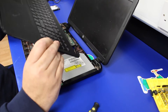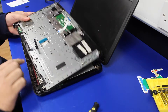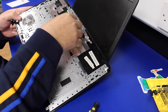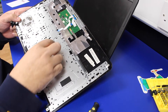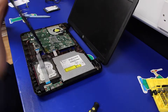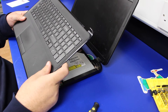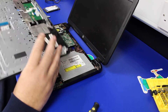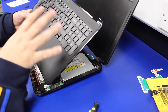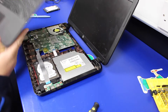With the cables already undone we can lift the whole top lid off the laptop. You can see there you've got the power cable here which runs to a power switch on the underside of the board, the trackpad cable that goes to the main board, and that's the keyboard lead just coming out of the metal underneath. I'm not a great fan of this design where the keyboard is an integral part of the machine's case, but it seems to be the way most laptop designs are going now. It just means that when you have a faulty keyboard, we end up replacing the top half of the machine rather than just the keyboard itself.